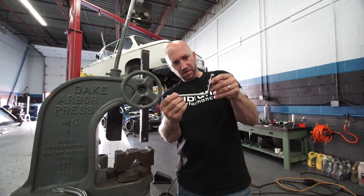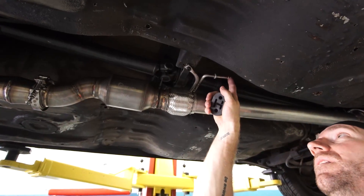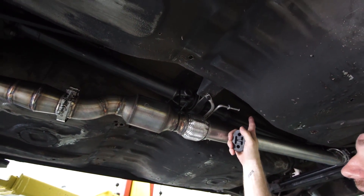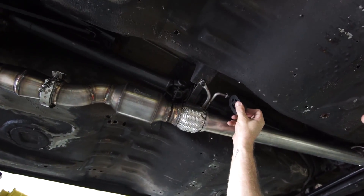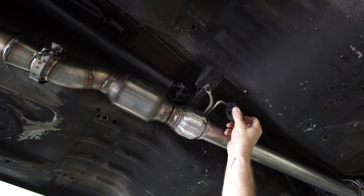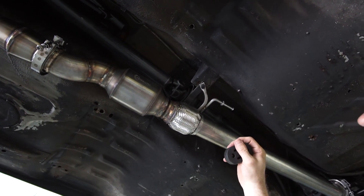That's pretty close to 90 degrees. So I've just tack welded this hanger rod onto my bracket. You can see it's pointed slightly up toward the back of the car, and the reason for that is when this grommet's sitting on there, if it's going to slide one way or the other, I want it to slide towards our stop and not towards the end.